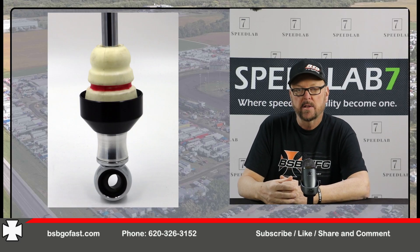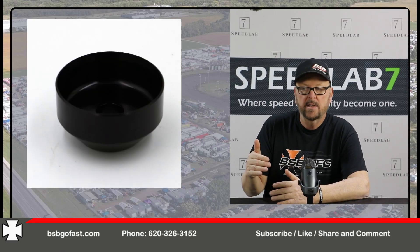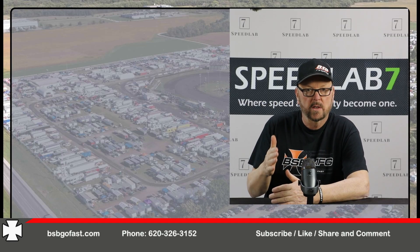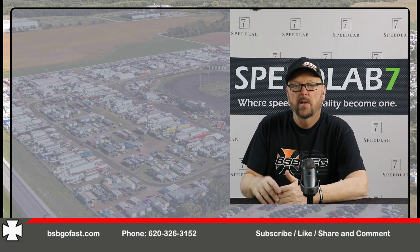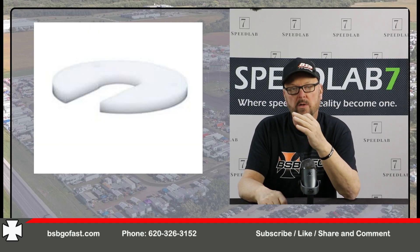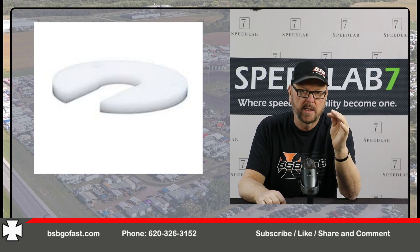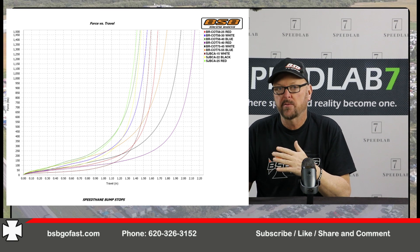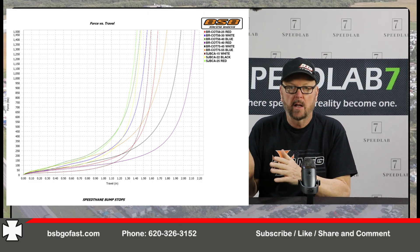Things like packers, bump cups, and spacers are all something you need. We make different types of bump spacers to elevate the cups and different cups in case you don't have this type of shock eye — these all work in conjunction with each other to get the bump close to the height you need. Once we get it close and start fine-tuning, we use bump packers, which are just a small shim that increases the bump rate — a sixty-thousandths, a sixteenth of an inch, or an eighth or quarter inch. Right at the end of travel it makes a big difference, so maybe we put in a couple of packers for a heat race and pull one out for the feature.